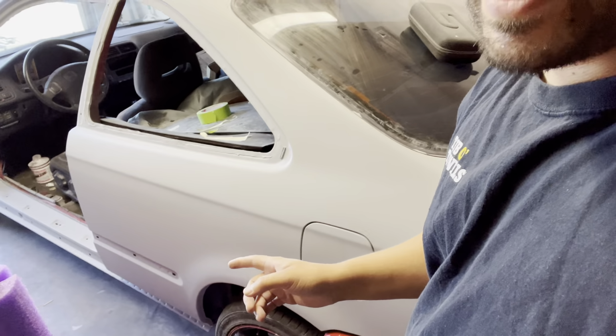Alrighty, guys. So we got the Civic unwrapped. This is the next day after the primer job. We got to pull it outside because I really got to look at this thing and see if that paint reaction is gone, because if it's still visible, we could end up with a problem when we go to spray it. So let's pull it out, see what it looks like, and see if there's something we can do to fix this car if it is bad, or if it is okay to shoot base and clear, because I plan on shooting base and clear tonight.